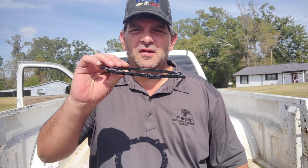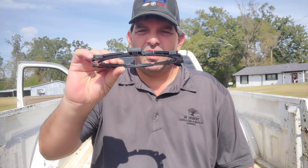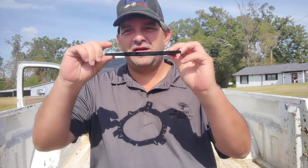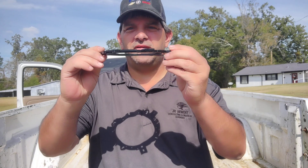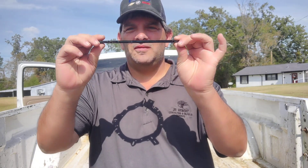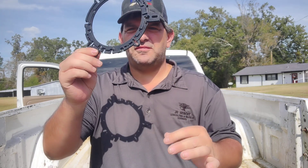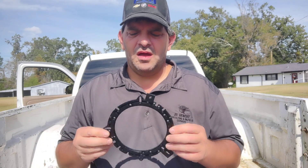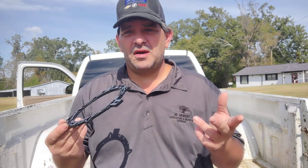The manufacturer sends you a thin ring like this to mount it on. Now, if they wanted you to use something that's 3/4 of an inch thick, then they would send it to you. They're suggesting without saying a word — this is what you need, this is what works best. So find a material; you can even use this to set up a fiberglass ring. Use a thinner material that works better, and you'll get a better mount, your speakers are cleaner, and your door panels are lighter.